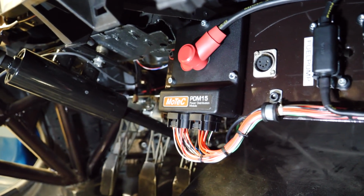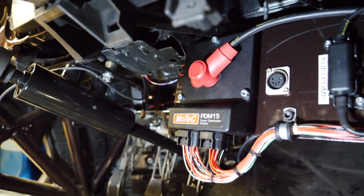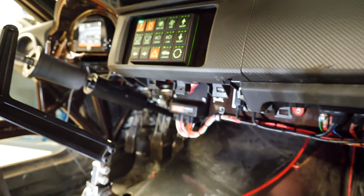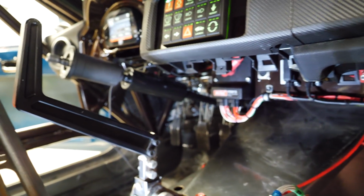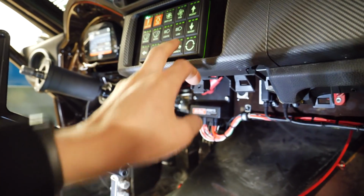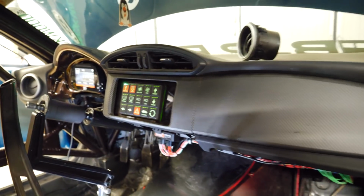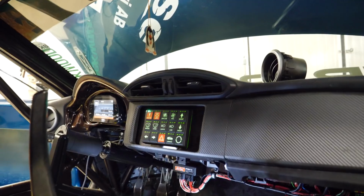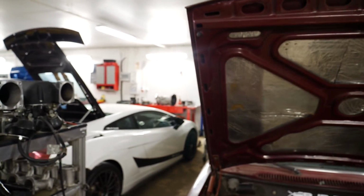You can do relay functions, and also you can select at what current the circuit breaker should trip, if the circuit breaker should reset itself, and how many times it should reset. And if there's a problem with an output like a circuit breaker, you get the message here, and then you can restart it if you want. So that's a smart thing that I really like, and hope to implement in the Volvo as well, even though it's really expensive.